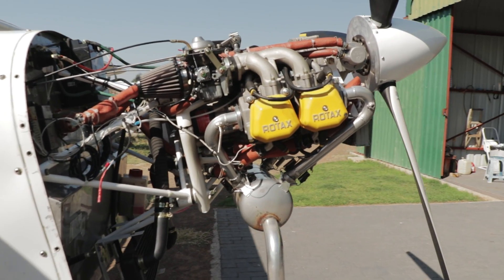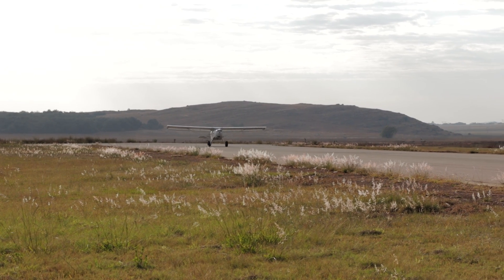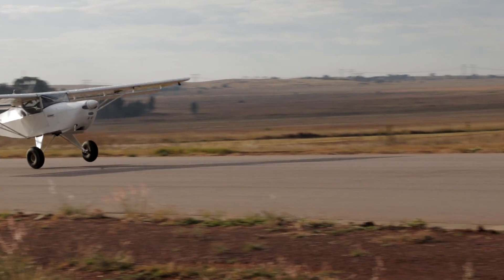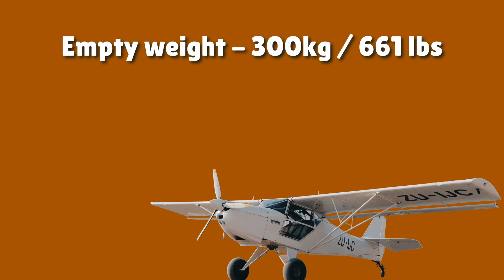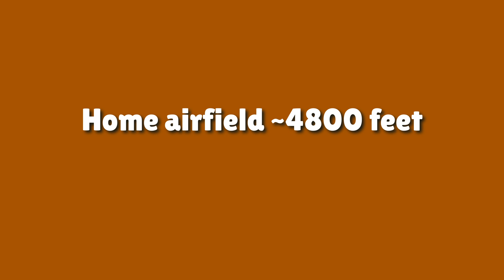The Bushbaby is an amateur-built kit plane from South African company KFA. Ours was powered by a Rotax 912UL with aftermarket high-compression pistons bringing its max power output up from 80 horsepower to 95 horsepower — ever so slightly lagging behind most 912ULS-powered 100-horsepower Bushbabies. Its empty weight came in at around 300 kilograms with a max all-up weight of 600 kilograms, giving a theoretical useful load of 300 kilograms. At the airfields we fly from at around 5,000 feet elevation, with density altitudes rarely going below 6,500 feet in summer, loading it heavier than 550 kilograms was looking for trouble from a takeoff and climb performance viewpoint — though at sea level it shouldn't be much of an issue.